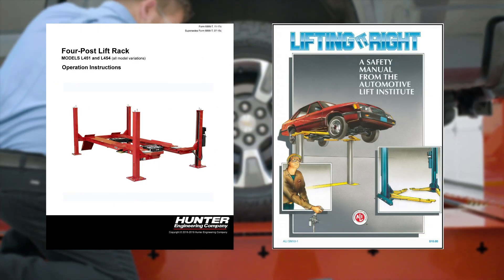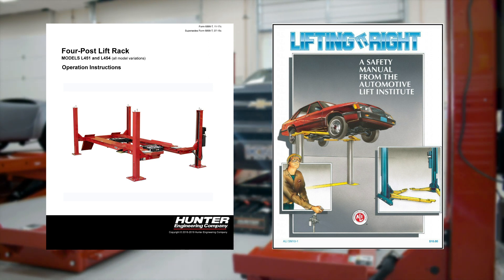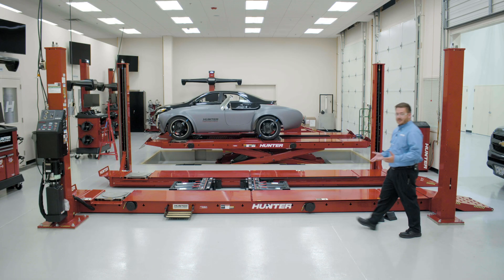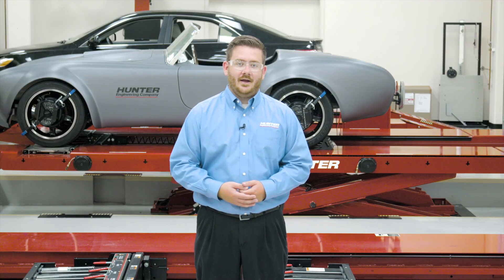We've brought the vehicle back down to the floor. The next thing we want to do is back the vehicle off of the lift rack — we'll remove our wheel chocks from the rear tire and use our off-camera spotter to give hand signals to make sure we back the vehicle straight off the lift rack. Every Hunter product has a dedicated operator's manual that can be accessed on their webpage. This brief training video is a supplement to published operation and safety materials provided with this product — please review and understand all of these materials before using this product. Those are the proper techniques for using the Hunter four-post lift rack: we brought a vehicle in onto the runways, lifted it into the air, used the swing air jack to lift the vehicle off the runways to perform undercar service, lowered it back down to the floor, and backed the vehicle off the lift. For information about Hunter lift racks and all other Hunter products, visit Hunter dot com. Thanks for watching.